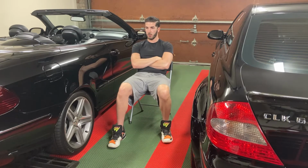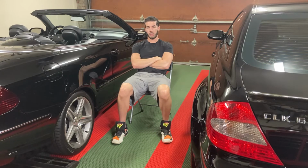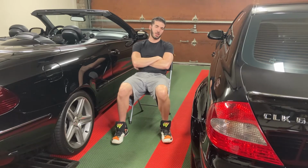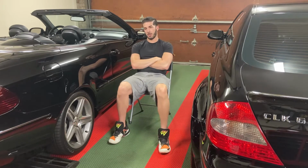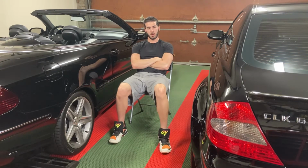The actual Evo 1 also had 18-inch Evo 6-spoke wheels on it. They are the Unilug wheels, which go on there. I didn't want to do the conversion, mainly because it takes something like 400 foot-pounds of torque and a special tool to put it on. Cross-threading is high. The material's not even steel, it's aluminum. Not very smart to put on the car.